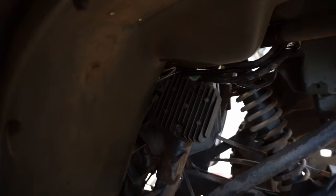Right. So I had the quad turned on. We had the problem with the white and black wire. Seemed to go away when I took the CDI off, so I'm guessing it's probably something with the CDI. But then this thing started making a whining noise, like that. So I unplugged it, that went away. But it's getting really, really warm. So something is not working correctly with this thing.